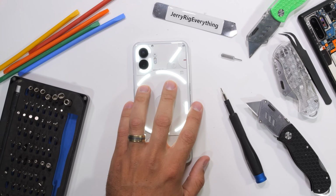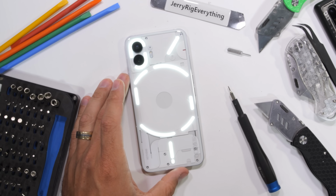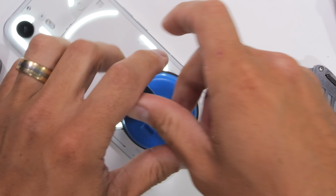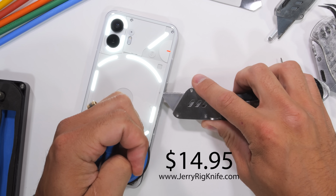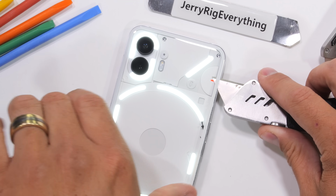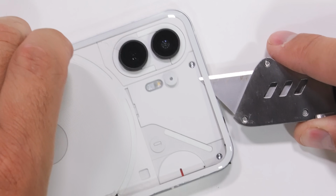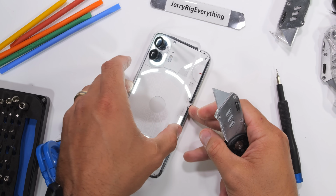The Nothing Phone 2 is IP54 water resistant, good for a few splashes here or there, but definitely no submersion. Like always, heat is our best friend during the back panel removal, along with our trusty matte black Jerry-Rig Everything razor knife, $14.95, link in the description. Lifting up on the panel with a large suction cup, the blade sliced just below the perfectly clear back glass, cutting through the adhesive to help lift the glass from the frame. And you gotta admit, the lights do look pretty cool.